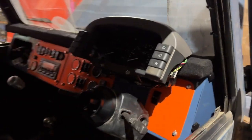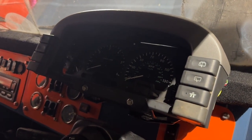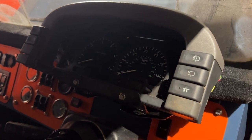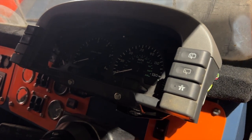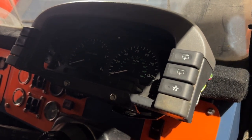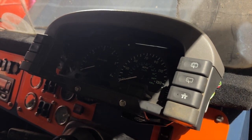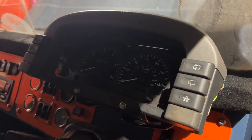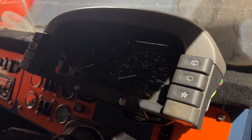Let's see what this little patch is. I had to put another set of clocks in — the temperature and the revs stopped working, so annoying. I put another set of clocks in and the mileage was flashing because it wasn't the right clocks — it didn't match the BCU. But I just realised my Snap-on machine can calibrate the two, so it's now reading the BCU mileage, which is the original mileage. That's handy to know for the future.